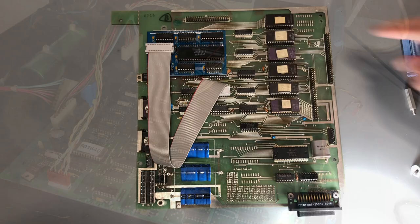The board's installed. Now if we want to run Super OS9, we need Super OS9 software. Let's go grab that now. OS9 is heavily reliant on relative files. At the time of this video, none of the available modern storage solutions like PetSD Plus have relative file support sufficient to run OS9. It has to run from a real Commodore disk drive.